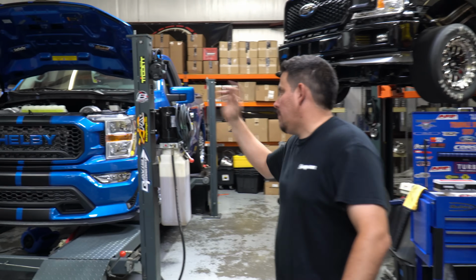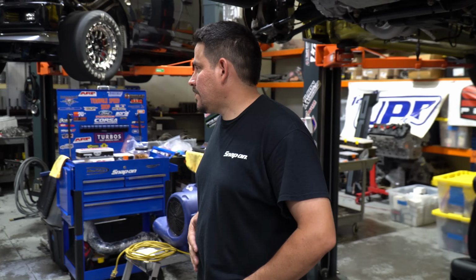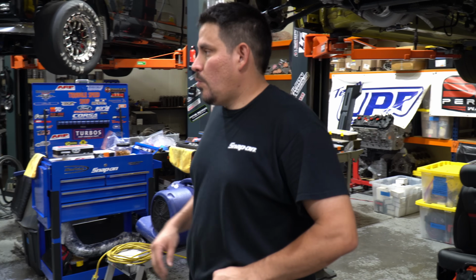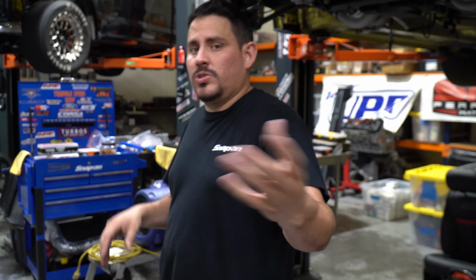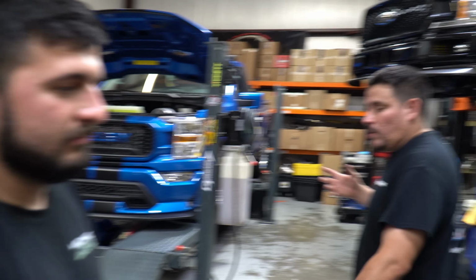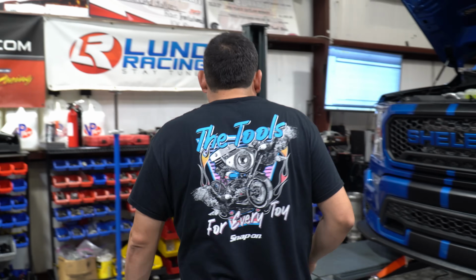We went from 62-62s straight to 64-66 journals. They made 838. I think the next thing would be to test it on the street. We added meth, but it's just a single little nozzle with stuff that we had here. Because we are pushing it, the truck's on 93 and stock pumps.